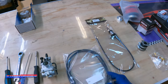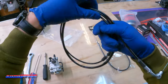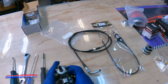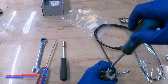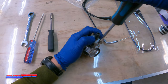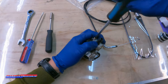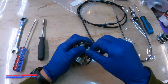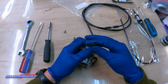Next step — you're going to take your throttle cable and you can do this in any orientation you want. Now what you're going to do, you're going to take your Phillips and you're going to gently remove these screws here. Hold your hand over the cap so it doesn't fling out and you don't lose your spring. It doesn't have a whole lot of pressure, but still it's something that can fly across the room, and then you're wasting time looking for a spring or emailing us asking where to buy a spring.